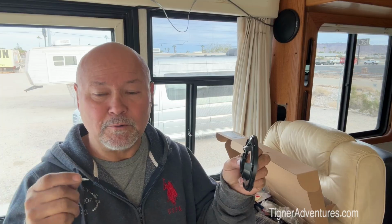So anyway, it comes with some cheap little screws that you would screw into something like pre-drilled wood or maybe sheetrock. In our particular case, we're drilling into the outside of our rig, which I'm thinking is going to be fiberglass where we come through. So I've got some of these self-tappers that have the little 1/4 inch nut on the end, because those Phillips head ones tend to strip out. This has a little piece that goes on there and just locks right on. It's got a little magnet on there, so it's pretty nice. It sticks through that much, so that should be a pretty good hole. There are 3 of them on each one of these, so that should hold it on pretty well.